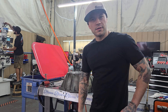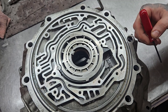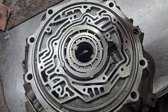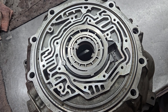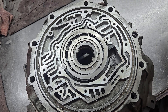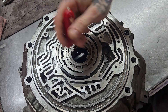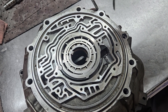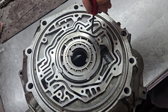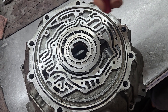Evan was making entirely too much noise so we moved over here. The biggest issue with the 6L80/90 — among several others — is converter clutch failure, which fries and sends debris to the pump, tears up your bell housing and pump backing, and causes a lot of problems. As I always preach: tuning — turn that Active Fuel Management off, and get a good converter. The stock ones are not adequate, mainly due to the stator. Cast aluminum ones are not good.